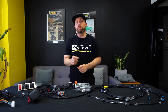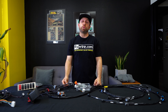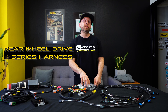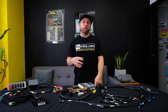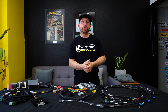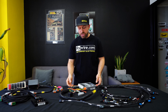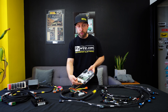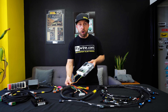Next I'm going to make things a little bit more complicated and show you guys some of our newer product line. The next wiring harness I want to introduce is our rear wheel drive specific harness. This one varies a bit because it's made for guys putting a rear wheel drive setup in their car with a longitudinally mounted engine and a couple of different transmission choices. The main thing I want to go over is actually the way this plugs into the ECU — it's going to incorporate all three ECU plugs: the A plug, the B plug, and the E plug, all on the engine harness.